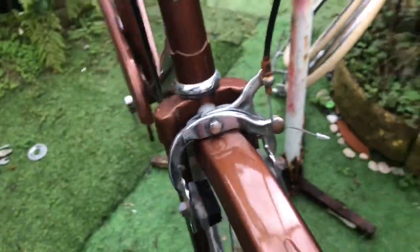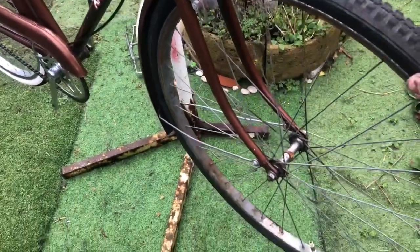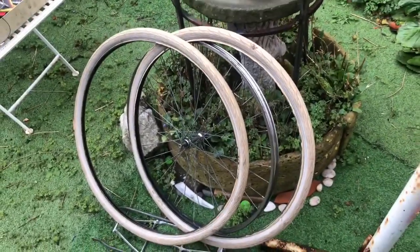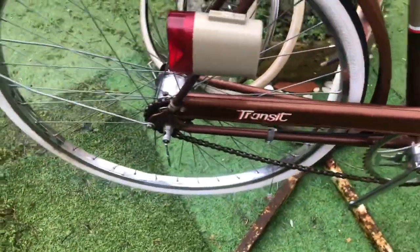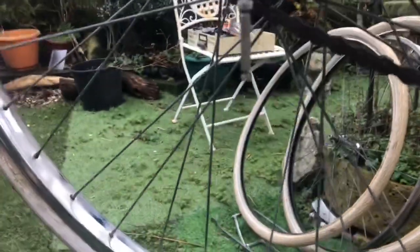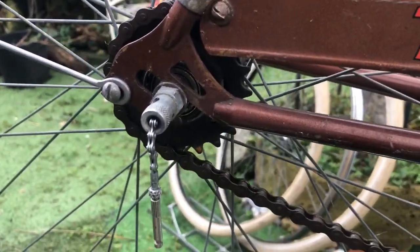Things like little nuts and bolts and fastenings to be replaced because they're rusty, and that takes extra time. The front wheel is coming out. I've got a spare wheel already and the tyres all ready, or they could do with a scrub. I'll put some pedals on last. We need a new gear cable, and looking at it I think we might already have a 20-tooth on the back of there. If not, I have one here. That might be an 18 that's on — I'll compare it when I get the wheel off and put the bigger one on.